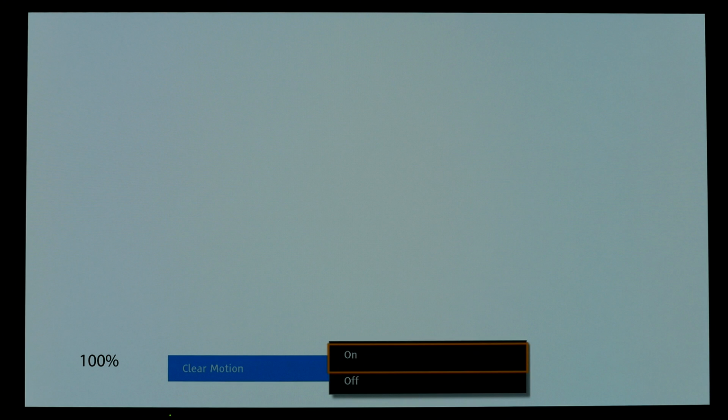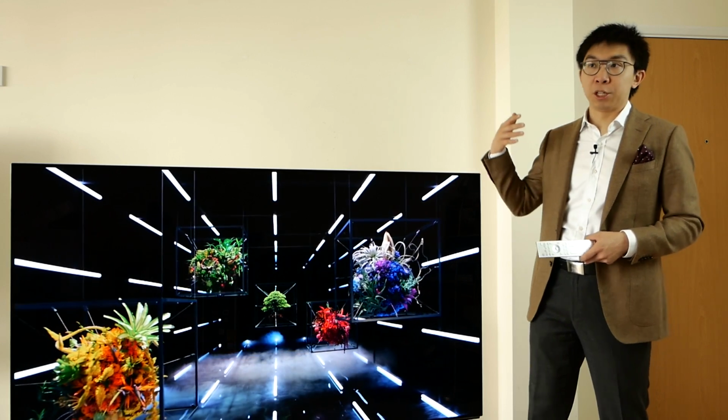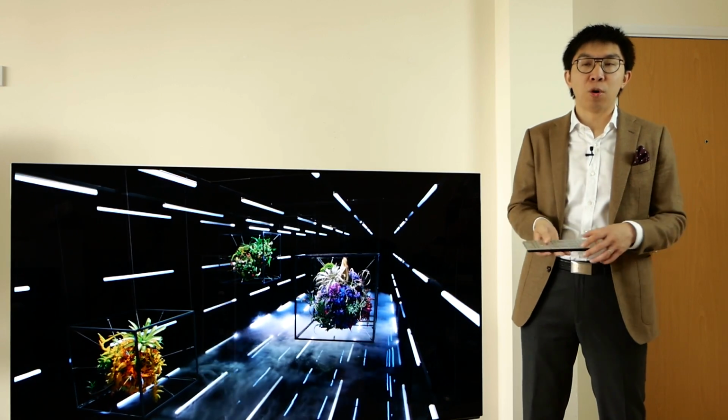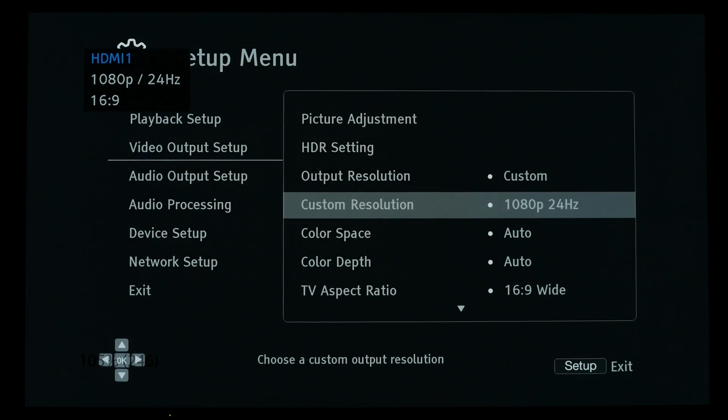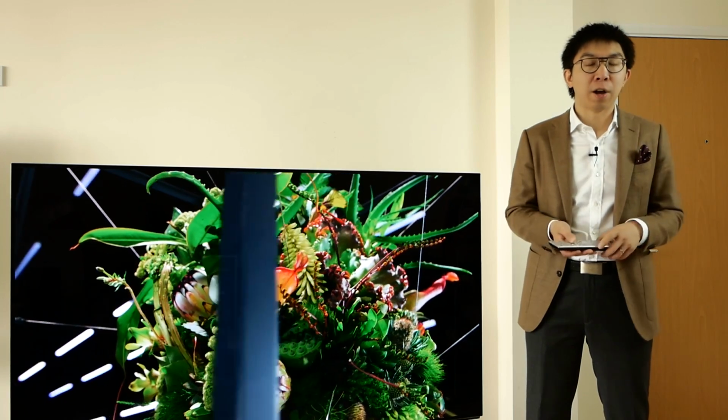By offering a BFI mode, this already elevates the Panasonic OLED above the LG OLEDs, which don't have any BFI, or black frame insertion. So the main competition is with Sony, which has a BFI mode, and Panasonic has a slight upper hand in that sending a 24 Hz signal to the TV doesn't introduce as much flicker as the Sony OLED when you engage BFI.